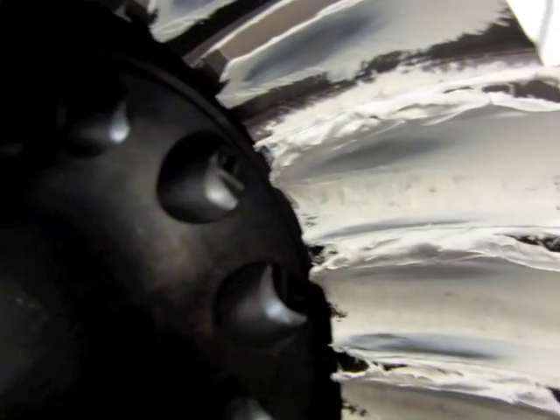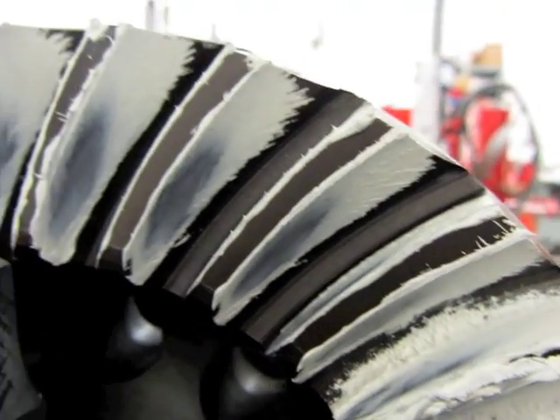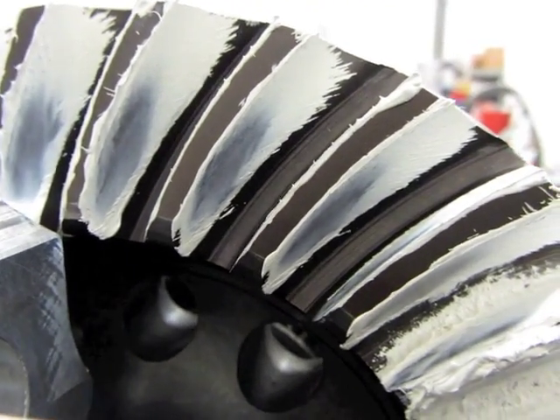You have toe-to-toe contact directly across from one another. This is what I call the ghost pattern — there is no marking compound put on here. It's simply been rubbed onto the pinion and then wiped off onto the ring gear. You'll see you have a nice full gear tooth contact both drive and coast.